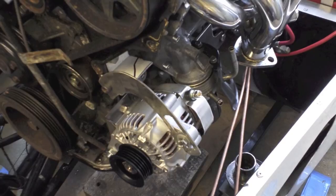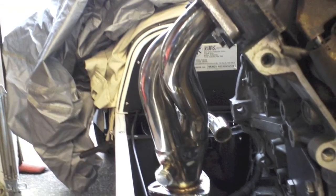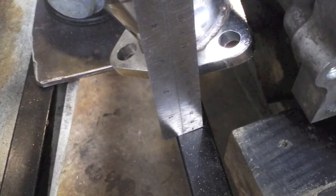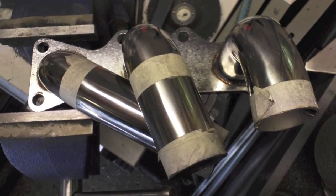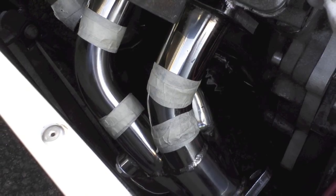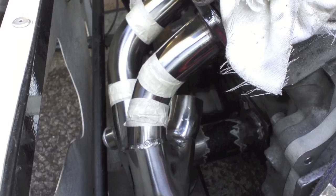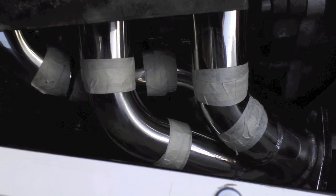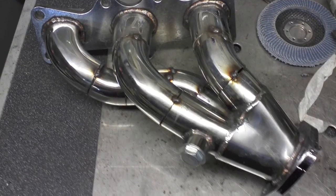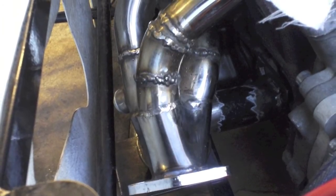To make it simple, here's a test fitting showing how far off it was going to be. They looked nice and shiny but I always knew I was going to have to cut them up — they both came with lambda sensor ports as well, which was good. You can see how little clearance there was down to the chassis. First we did the near side one, started cutting it up, trying to reuse as much of the existing tube as possible. Cut the collector off at the most convenient height to weld it back together, and basically it was a case of a jigsaw puzzle — building up a manifold to turn the tube towards the rear of the car so we could get the flange to a position where we could turn a 90-degree exit out through the side. Taped everything together, once happy tacked it with a MIG and some stainless wire. Pretty horrendous welding but eventually got it all welded together — hopefully it's gas tight and it's in a nice position, giving plenty of room to exit through the side of the car.